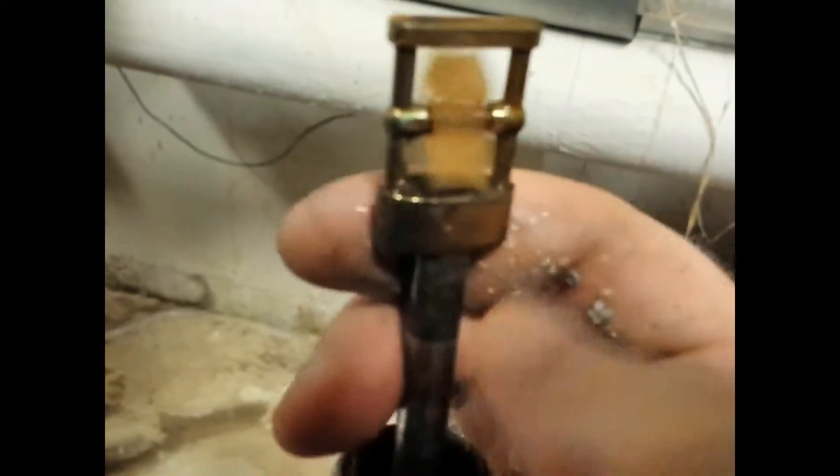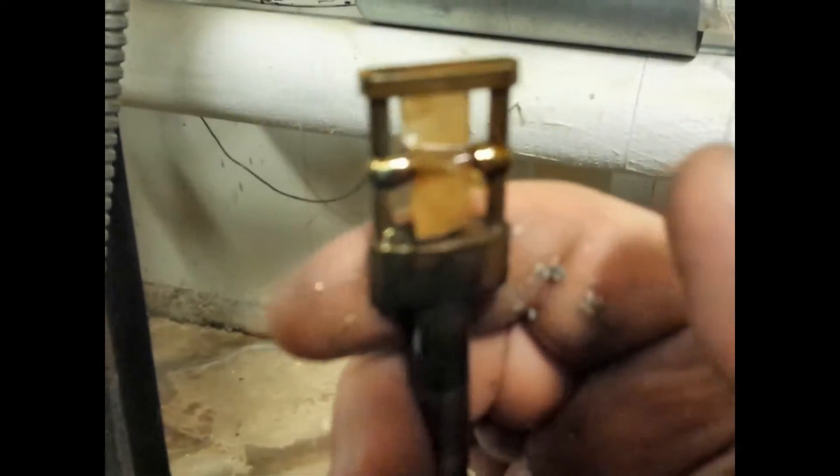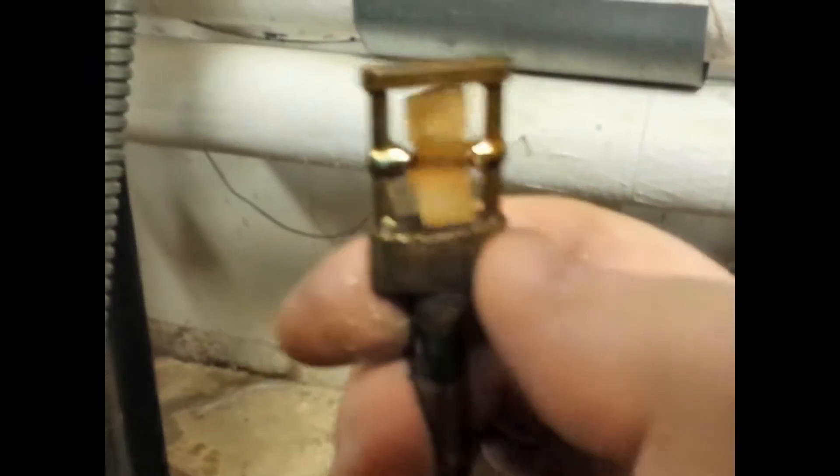As you can see, you'll get a little trash that comes out. The impellers on these will become clogged often with trash. The way that you can test these is simply by spinning them with your finger — if they stop immediately, there may be a problem. The other way is to just blow on them to see if they spin. As you can see, this one appears to be spinning fairly well.